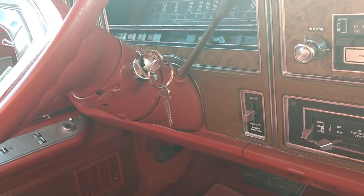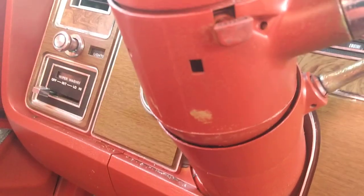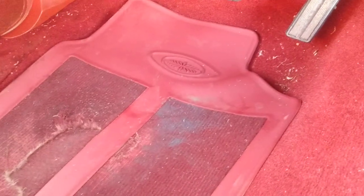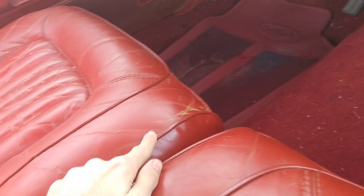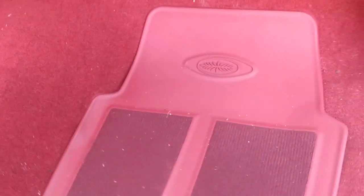I need to touch up any overspray — I've got another can of touch-up paint just for that reason, to cover it all up. Still a little bit of a mess from last night working on the gauge; I've got to vacuum the floor. I applied the fabric and vinyl dye when it was about 50 degrees, so I wouldn't be surprised that's why it's chipping off and cracking so easily — it's meant for a warmer temperature, but I wanted to give it a try.